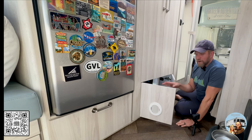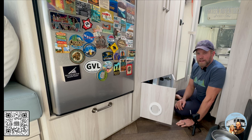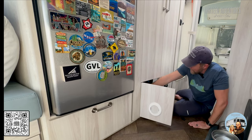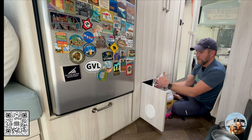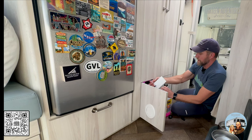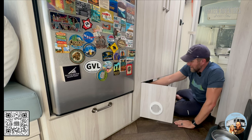Now that we're done winterizing the rig with antifreeze, every water line throughout the whole rig, all the low point drains, and all the inside spigots have antifreeze running through them. Now it's time to clean up. First, turn the handle back in line with the water system. There's a card attached to this hose that tells you which way to turn that valve, should you forget. I'll pull this hose out and let it drain as much as I can — it won't drain all of it. Put the cap back on, roll the hose back up, and store it back inside the water pump closet.